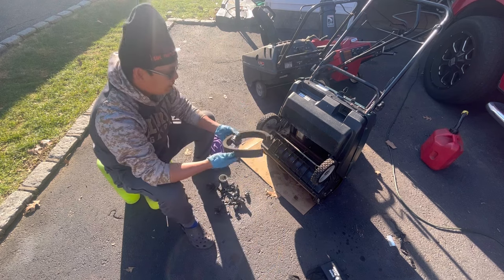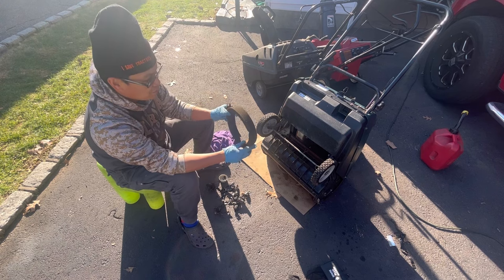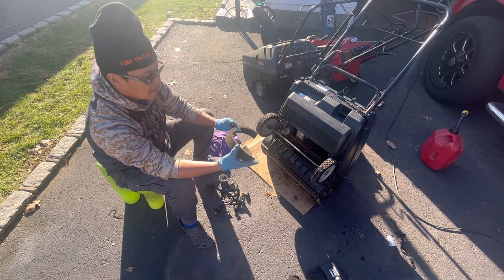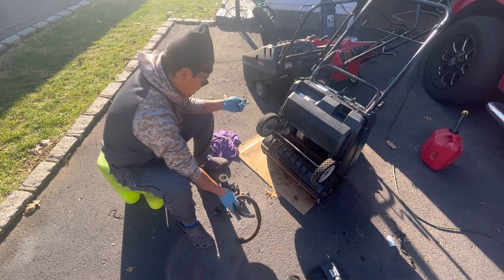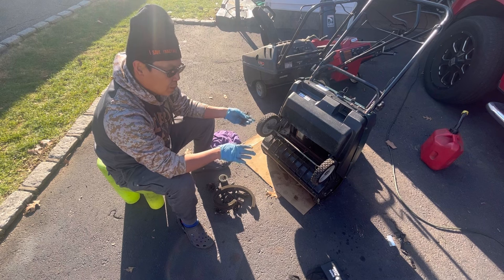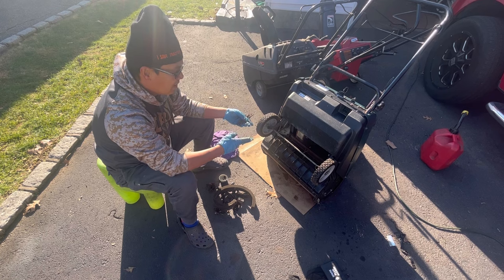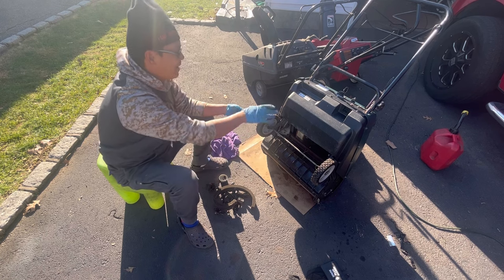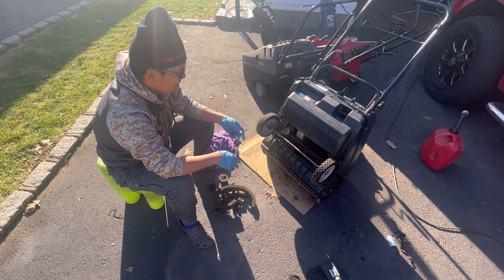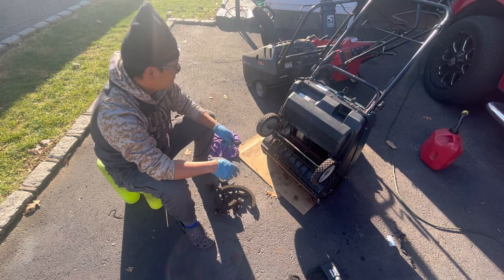And this thing came out, this is like the insulation for the chute rotation. But once it splits there, it's not going to stay there, not to mention it's all rubber foam anyway, and it's bad. I just ripped it out. So we cleaned the carburetor, changed the fuel bowl to stop the leak, fixed the fuel line, took this apart, and fixed the handle so it doesn't have all this mess over there. It works just fine, and now it runs and starts. And it runs better than these other two.